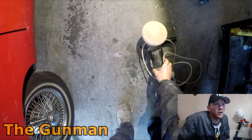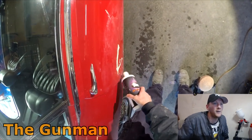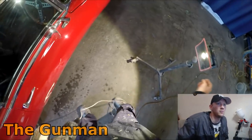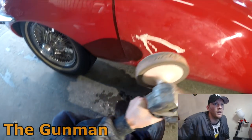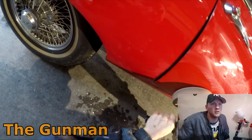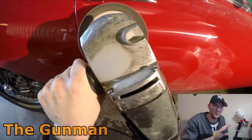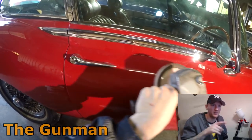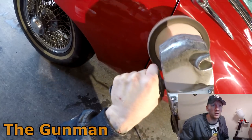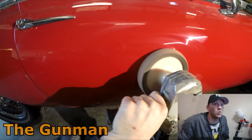If it was nice and clean I'd usually just opt to run the buff over it. Drying it off before I polish it — I don't like to polish over wet panels because it just makes an absolute mess, and I think it actually starts breaking down the compound as well. You're better off just using the compound without water. It turns out I tried using the Rupes Bigfoot, which is like an orbital polisher swirl-remover type thing, and it does happen sometimes that it will actually ruin the blend — it'll look good off the rotary buff and then you go and use the orbital and it'll show that edge right up. Straight off the buff, give it a bit of a hand wax and leave it.